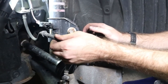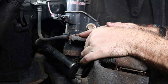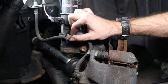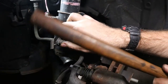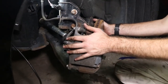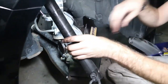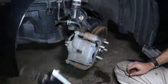Don't forget to reattach the brake line to the intermediate bracket on the strut tower. It slides in one orientation only — there's a flat on one side. Use something softer like the wooden handle of your hammer to tap the retainer clip back into place. Straighten the tire back out, and at this point check that no connections came loose or are going to rub into anything. We look good — ready to get that tire back on.